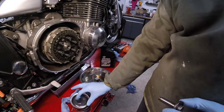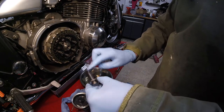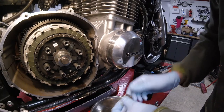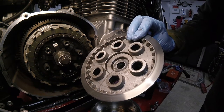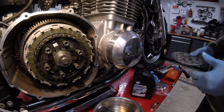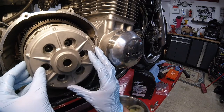Here's the moly grease — a little bit of that on the shaft, not too much. Next is the new needle roller thrust bearing, which needs a gentle lubrication, and that goes on the end of the spring plate push rod. Here is the spring plate and there's a washer that goes right in the middle — that washer goes on top of the thrust bearing. Then apply a light film of oil over the plate before fitting it.